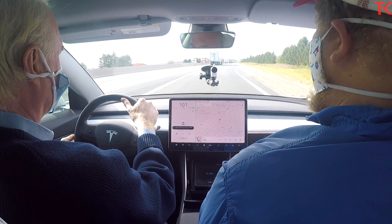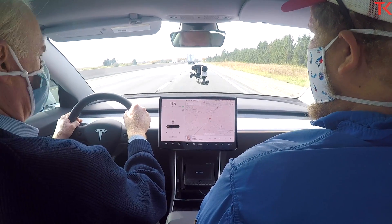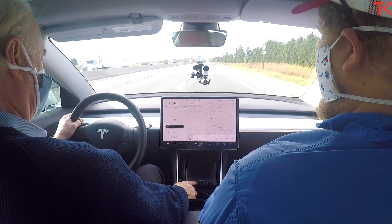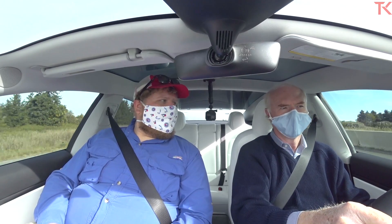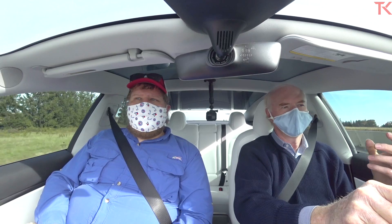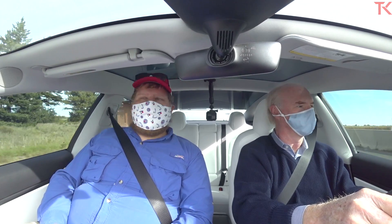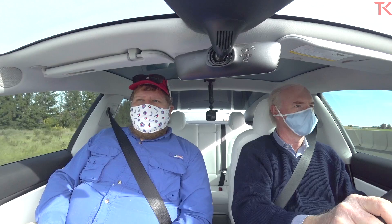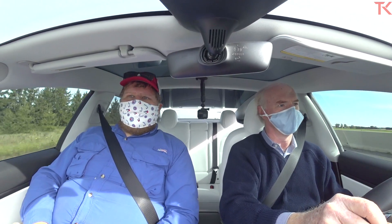In terms of sway, we've got sway controls as well, but the weight distribution is part of it. People might be nervous about the trailer being longer than the wheelbase should allow. But what we look at is the rear overhang as a percentage of the wheelbase — you can have a short wheelbase if you have a short overhang. What you don't want is a short wheelbase and a long overhang. That's a better number to look at than just the wheelbase in isolation. There's nobody around us here, so I can do a very quick lane change — wow, even over that crown of the road, and it just sits there. It feels rock solid behind it.